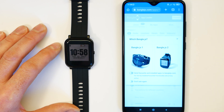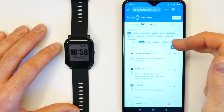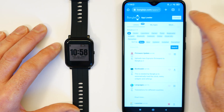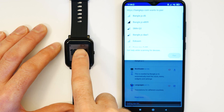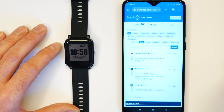When you get to the app loader window, choose which device you have. It's a good idea to tap 'don't ask again.' It really helps us if you send what apps you have installed — it's completely anonymised data showing the apps installed and the ones you've pressed the heart icon on. That allows you to sort by installed or favourited and see what other people have liked. To connect, just tap connect in the top right. You'll see a bunch of devices, and by default your Bangle will have a set of letters and numbers in the top right corner of the watch that correspond to what you'll see listed. Select it, tap pair, the Bluetooth symbol lights up blue and you're connected.